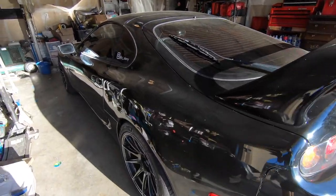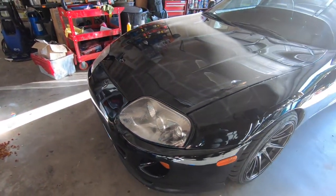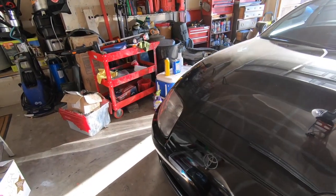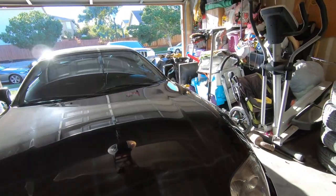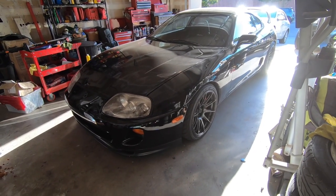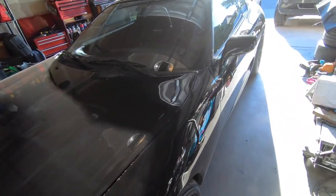The time has come to take out the transmission to assess the damage and see what needs to be replaced. I don't want to replace both things but I will if necessary. My main suspect right now is the flywheel — I read online that if it slips and you don't smell anything, it's most likely the dual mass flywheel. It looked pretty beat up from the get-go, so it lasting this long is kind of surprising. Let's jack up the car and start taking it apart.